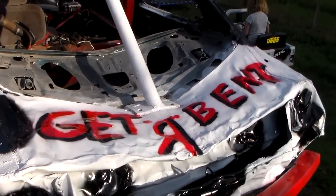Doors all welded. I forgot my roof sign but you know what that looks like. Got the homemade fuel cell with the Honda pump — good old Honda power right there. Got my door panel, and the cage — everything but that top bar is all three-by-three square tube. There's about 200 pounds or better of cage in this car. And yes, I'm still running EFI — I've had no problems out of EFI, but we'll see how this car does. Got the brain box mounted right there.